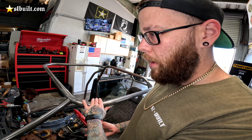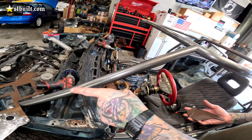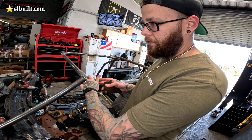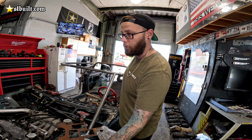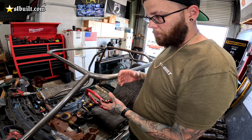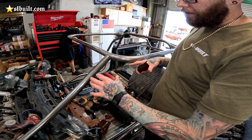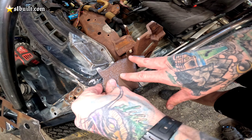What we're going to do is frame out the front bars that are going to attach to the halo. This one we're going to go straight to the shock tower because we're going to build it like a funny car cage from the front half — so it goes into the shock tower and then comes out here. We're going to have more tubing that's actually going to be like our core support. Once we get done with that we're also going to add a secondary brace off of here to make it a little more decorative — add a plate with a gusset and some dimple dies in there. This is basically going to get welded on here.